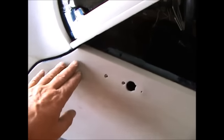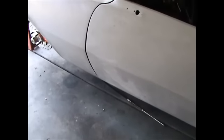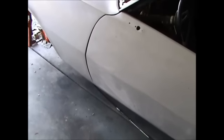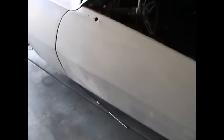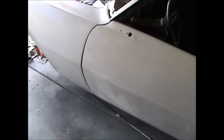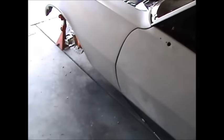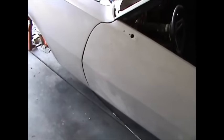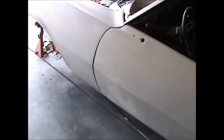Hey, fellas. I tinkered with it some more and I can't get it any better. The top of the door has to roll in about a 32nd of an inch and the bottom of the door has to roll out about a 32nd of an inch, and then we can go back to adjusting the fender. I didn't tighten down any bolts. I'm going to call one of my sons and see if they will stop by and give me a hand adjusting this door. This is all new to me. I've replaced doors before and done front fenders before, but going from the quarter panel and lining everything back up — it's all new. That's going to be it for today. We'll see if I get somebody over tonight and we can tinker with this door. See you guys tomorrow.